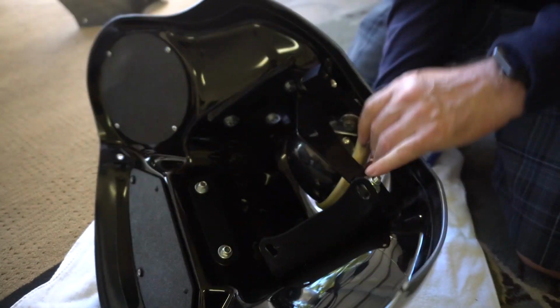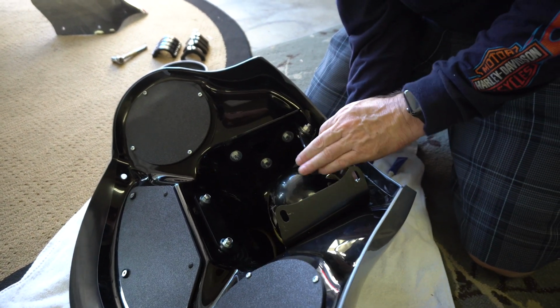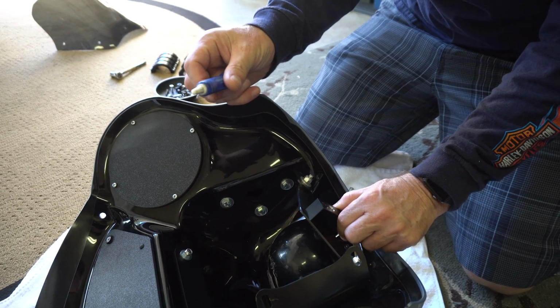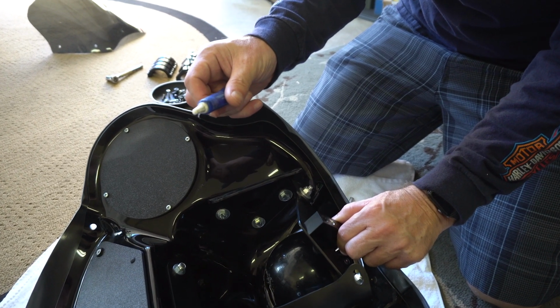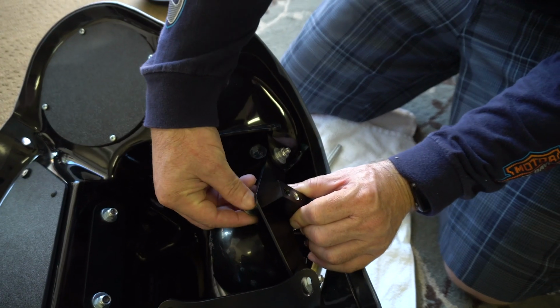Maybe I'm gonna slide it in there. There we go. So that is now officially slid in. And next thing I'm gonna do is I'm gonna put the bolt in. Make sure you use Loctite, guys. You wanna put something on there that's a thread locker. Harleys vibrate, things come off. Okay, one dab of Loctite. Should be nice and in there.